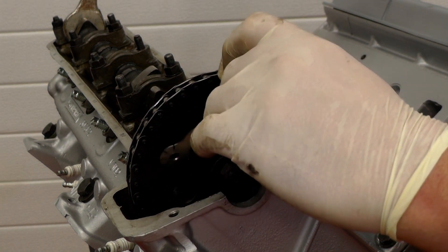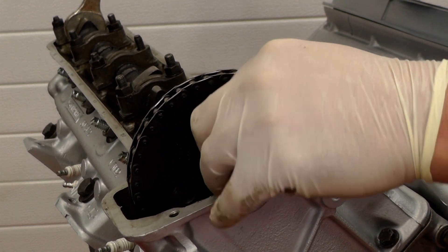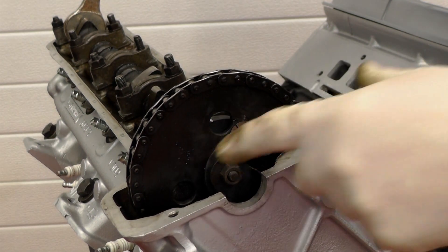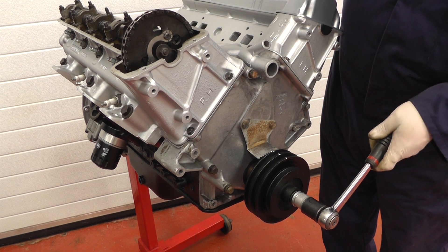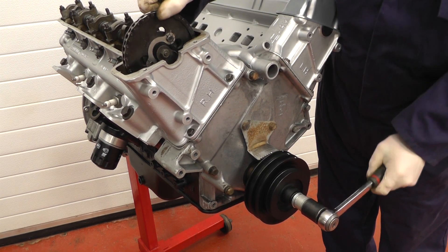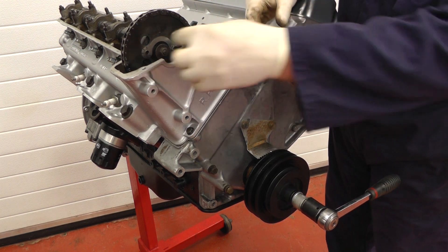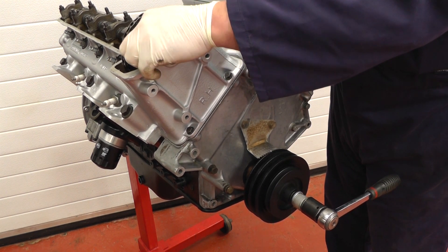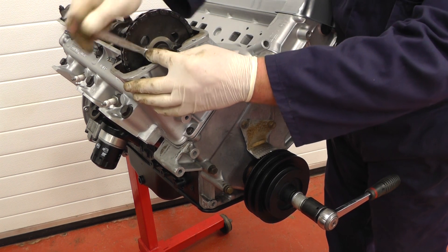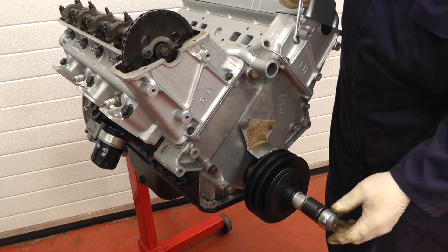With the new tab washer and bolts, carefully fit it in. If it doesn't screw in we can move the camshaft slightly until we feel it screw in nice and gently with the fingers. Once we have one bolt in we can then rotate it to get to the one lower down. I'm going to rotate it using the crankshaft to get to an easier position where I know I'm not going to drop it or lose it down the hole. As you can see it's going in fine. We tighten those two up and then have to bend the tab washers over.